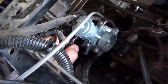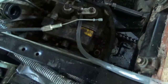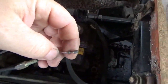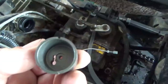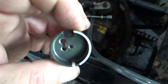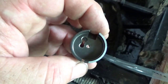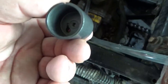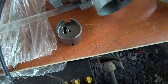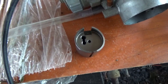Just reach in, put the choke on — maybe a winner! This is the throttle cable; you can see when I move the throttle it moves in and out. Unfortunately this doesn't quite work with this, so we're going to get out the drills and files. Whenever you go to alter something, it's better to remove too little material and go back ten times than to remove too much once and wreck everything. Take it nice and slow.